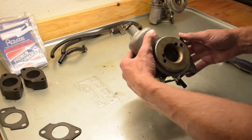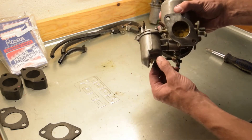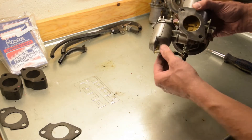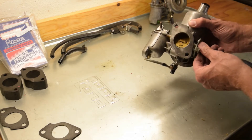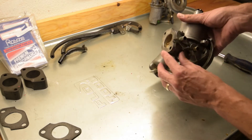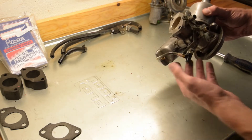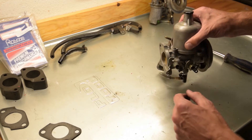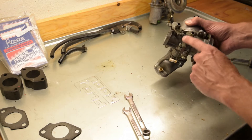We're going to look over the carburetor — this is the one that was leaking from the jet fuel hose, and there is the main reason why. We're not going to remove the butterflies; we're just going to keep those on and clean them up slightly. Everything else seems to be moving fine, so what we're going to do is replace the jets, the valves, and the gaskets. We'll start by removing the jet tube and the shaft.